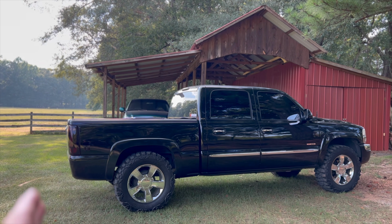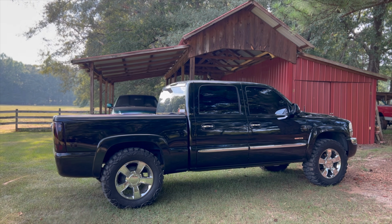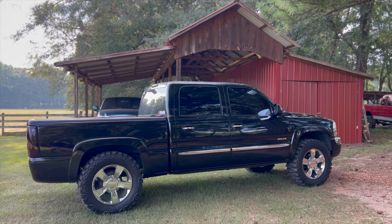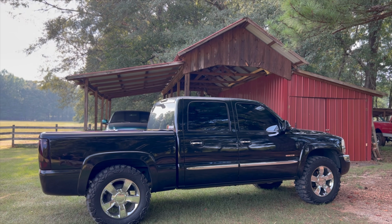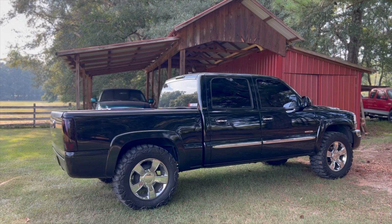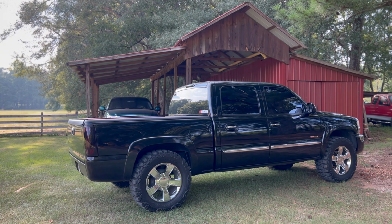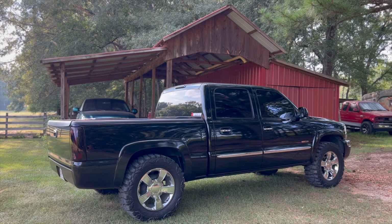A full out the back. We're gonna go full length. We're not gonna do a turn down. Do we do true duals? I already know I'm not doing just straight pipe true duals. There's no way, because it's going to be this loud and probably be super choppy. So we're going to do a muffler. What's I saying? True duals? It's not true duals. It's got an X pipe, so it's not true duals. Oh, true duals with the X pipe, whatever you want to call it.